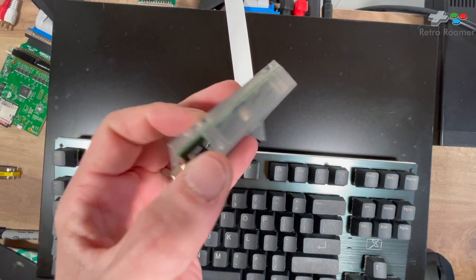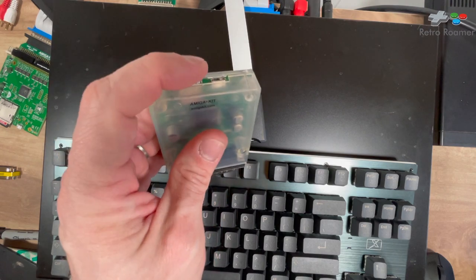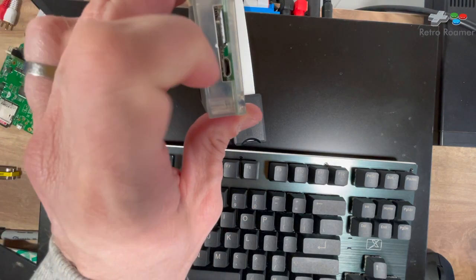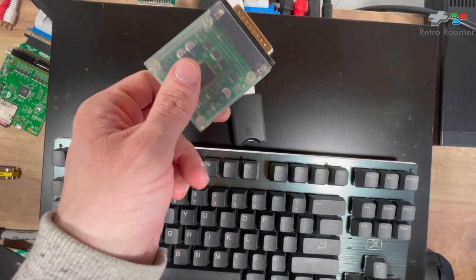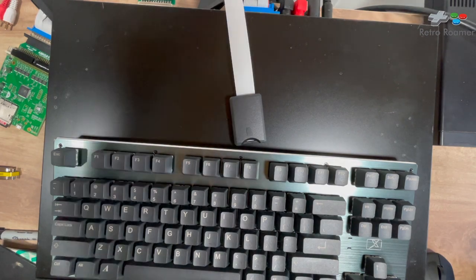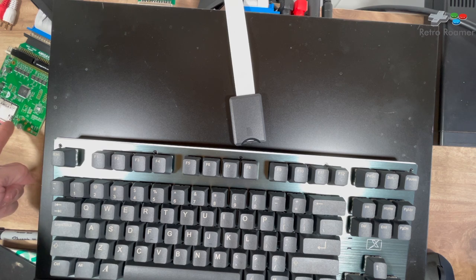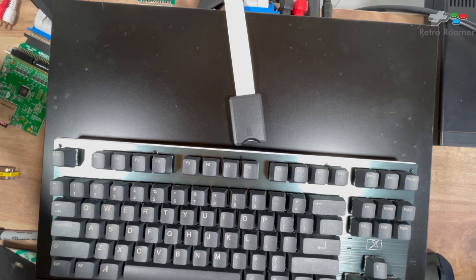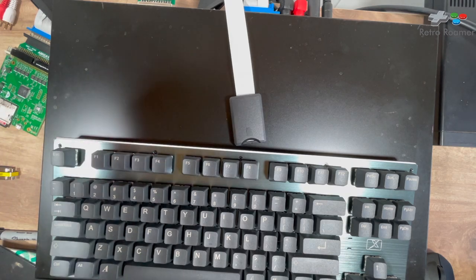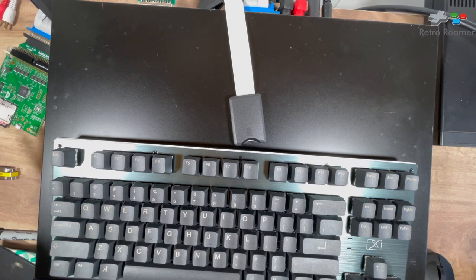I've moved from using the 5.5 because whatever I do, it corrupts pretty much instantly on here and needs the 5 volt to power it for some unbeknown reason, just off here, but works fine on an A570. But I now have the good old 5.2 from Amiga kit, and everything so far is copied over and working, but I had to copy it folder by folder, one at a time, and double check, because it does corrupt itself when you try and do it.